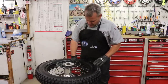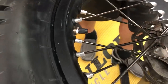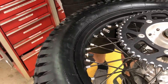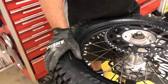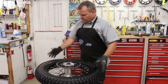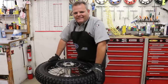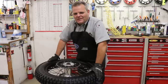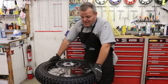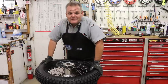Cap goes on — now this is really important. When you put the cap on, you want the nut to stop just like this. This is how it should look — it's going to allow room for the tube to move. If you don't, it'll tear. If you get low on pressure or turn, you'll tear the stem right off the tube. So you want to have that nut backed off just like that. So that's pretty simple — hopefully that helps you out. We're going to get Rado some tire-changing experience here soon. He's got some experience but it's been a few years since he's done his own — I spoil him a bit. That's all there is to it — we'll see you later.